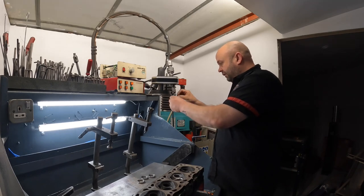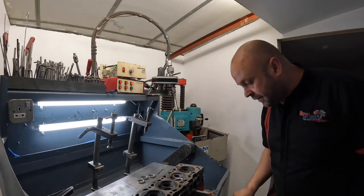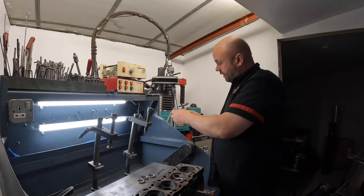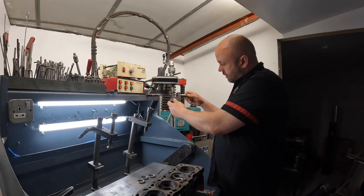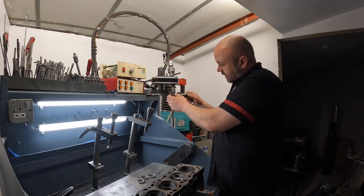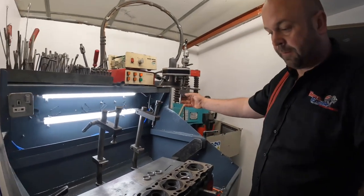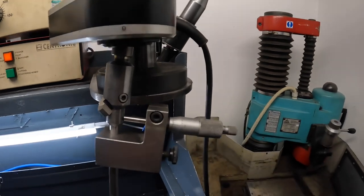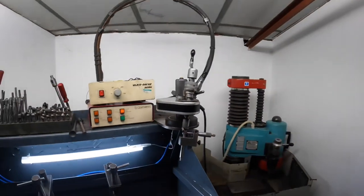The first thing I'm doing is fitting the pilot for the setting tool. This is a tool-setting tool — whenever I fit seats I just zero it off the body of the machine because that's what it's set to. This is 669 thou — this part of the machine. So basically when I measure the OD of the seat I minus the 669 thou out of it, and as you can see that's bang on zero if the camera's picking that up.